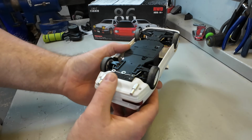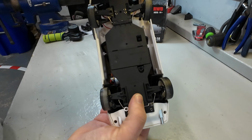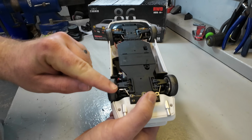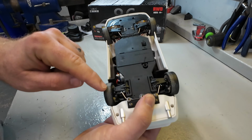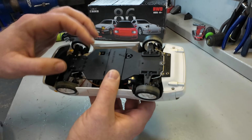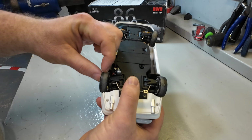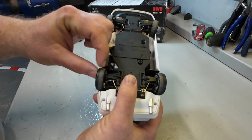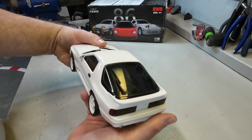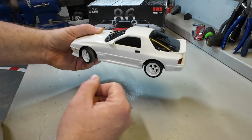But here's the other thing I started to notice as I looked the car over. We noted that the suspension is adjustable, so the alignment can be adjusted both front and rear. And I'm noticing now that I've driven it some, look at the wear patterns that I'm getting on these tires. When you drive a drift car on a hard surface, the wear pattern on the tires can tell you a lot. And notice how on this, the right rear of the car, I'm actually wearing almost the whole tire. So I've really used a bunch of it, and I'm hitting a lot of that. And it turns out drifting that direction with that on the outside was the easier way to drive for me.